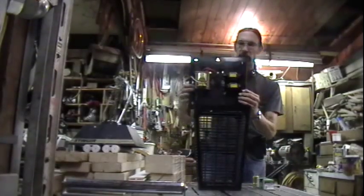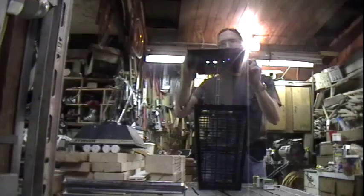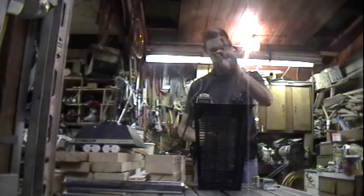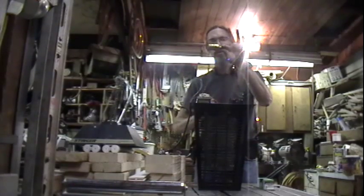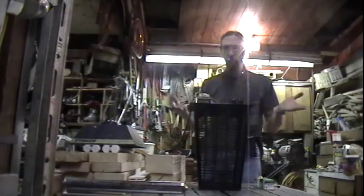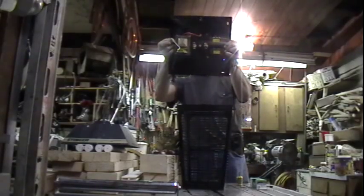When you look at your circuit, you'll notice a knob right in the center between where the two connectors went. Some fluorescent lamps only have one bulb, in which case the electrocution grid is smaller and you have a little less room to work. What we want to do is drill a hole right in the center of that knob that will fit the stem that the fixture screws into, in order to mount our fixture inside the casing. I'm going to pause the video, do the drilling, and be right back. Okay, now we have our hole drilled right in the center — that's going to hold our light.